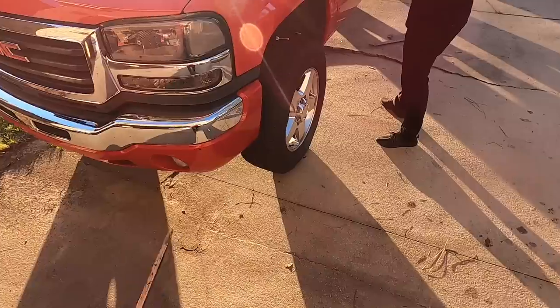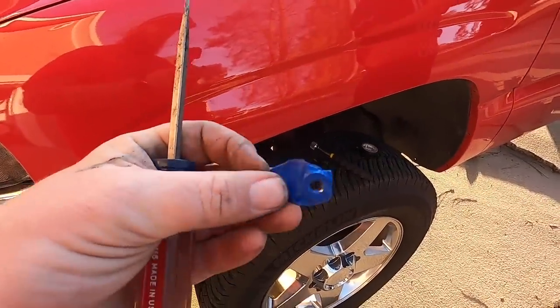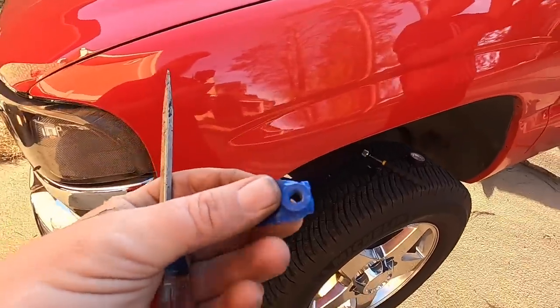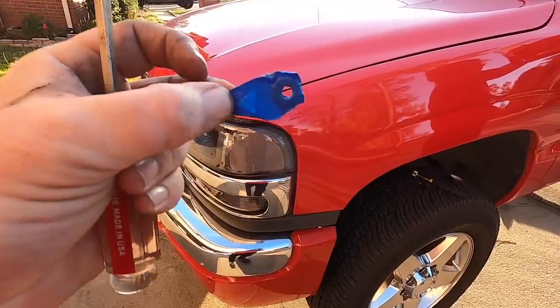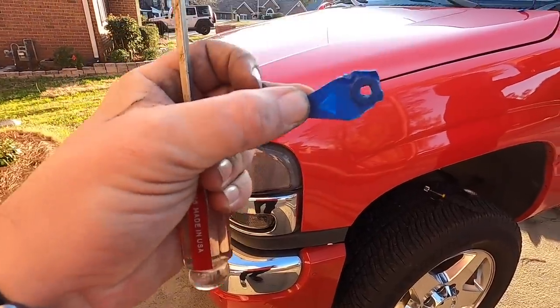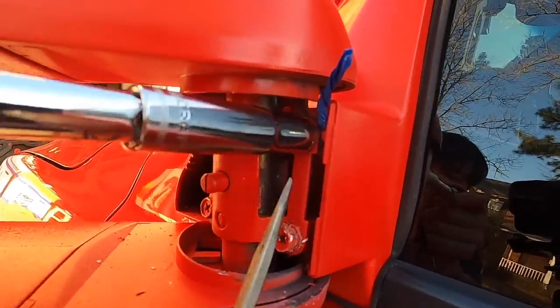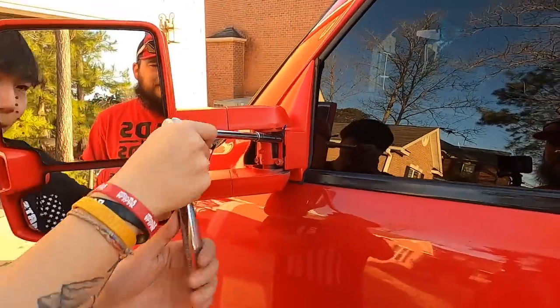All right. So, trick that we figured out, so we're taking the painter's tape and wrapping it over our three washers and then puncturing the hole with the bolt, and then we'll use the painter's tape as kind of like an extra finger to get it up in where it needs to go. So JW took this side, fished it in, and then kind of rolled the washers with a flathead and got the three behind it. Yep.